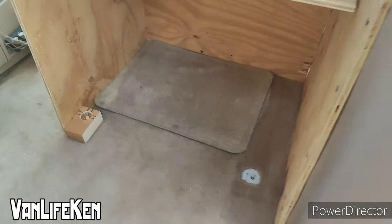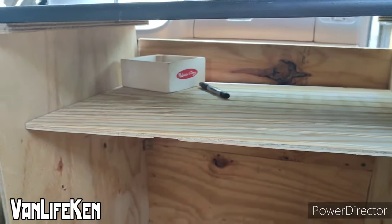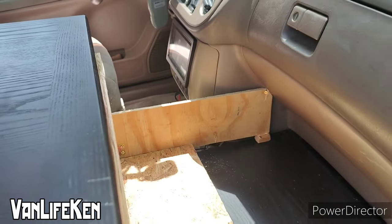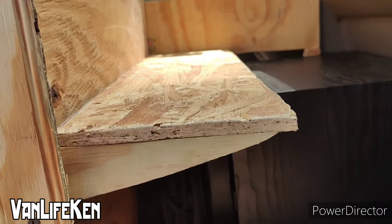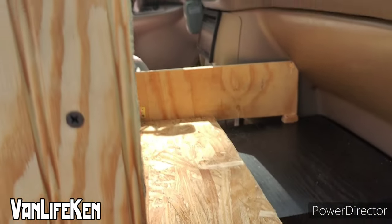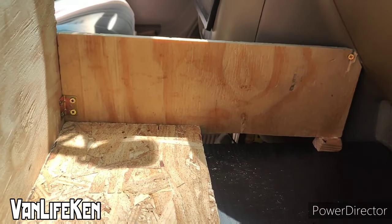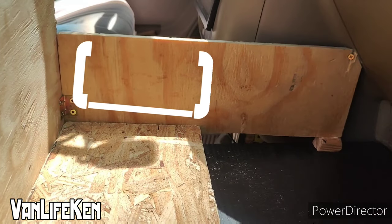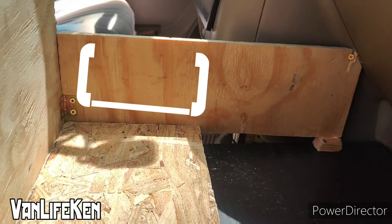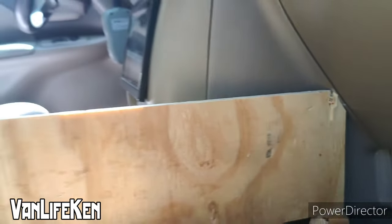I haven't recorded too much in the past hour or two, but we've got a full back on it now that extends all the way up to right here, so pretty much ready to start filling this up with stuff. I've also added this side panel, as well as this shelf right here that allows for my toilet to be underneath as well as my little filing cabinet. That fits perfectly. I've got this angled piece holding it up solid. This piece is held on by one L-bracket over here. I just wanted to mention that I'll be cutting a slot in this piece so that I can access the storage underneath the sink countertop without having to open the door and go outside of the vehicle.